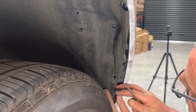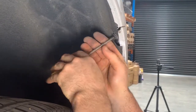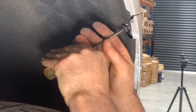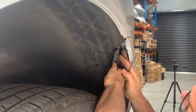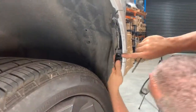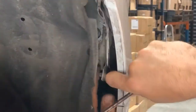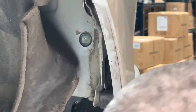We've got some more light to make it a bit clearer. We had a screw under here, a plastic lug there, another screw there, and also another screw in there. Now we're going to pull this back and reveal the actual bumper bar where she's sitting, and some of the lugs you need to pop off. We'll go and do the same on the other side and continue from there.